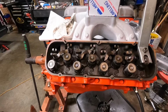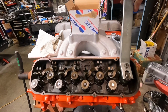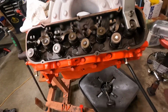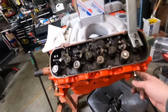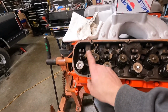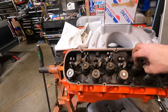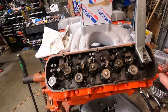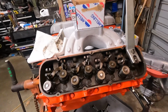All right, I'm going to jump on getting these valve springs swapped out. Just a basic Advanced Auto special valve spring compressor on the stud. Took my compression gauge apart because I can't find my normal one. I got air in the cylinder, and take a dead blow and just go along. A lot of times if you pop them one good time, then it will get the lock unstuck from the taper in the valve spring retainer. I'm going to change the retainers as well, but I'm going to get a couple of these knocked out and we'll keep going.